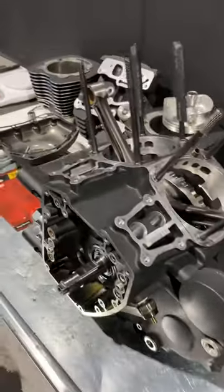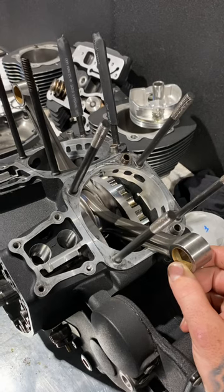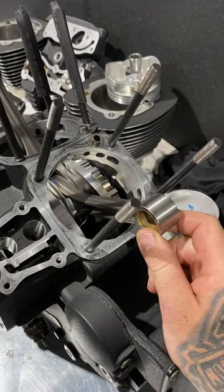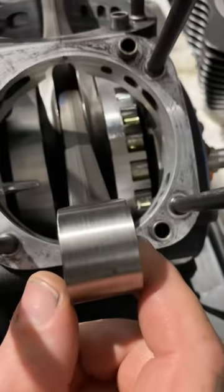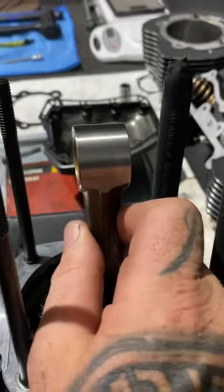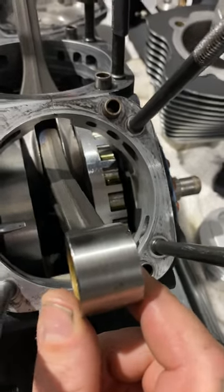This crank has been split and updated. The big ends have been machined because they were out of round, and it's had an oversized bearing set put in. Now the front rod, with the throw, I just don't like it. The rear you can feel — there's that pinch of throw — whereas the front, she's a flogged out old four-speed gearbox. I just don't like it.